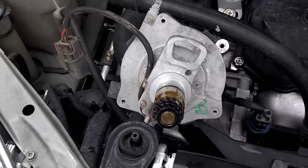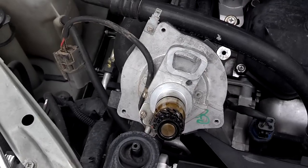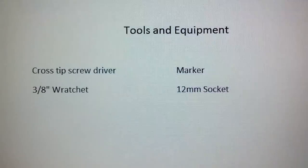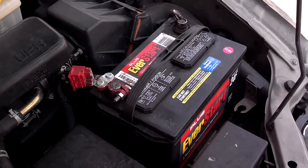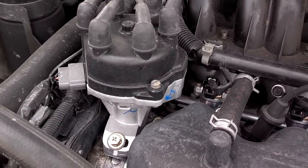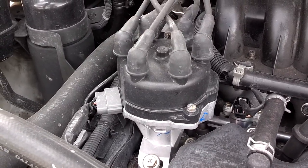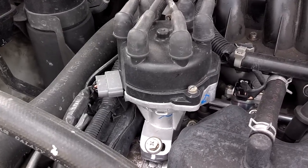You may want to take them up on a warranty because these things new cost about $350, and out of the salvage yard you could get them for about $40. The battery is dead on the vehicle so I cannot pull the codes. When I pop the hood it appears that somebody has already replaced this distributor with one from the salvage yard, and the owner didn't indicate she had any knowledge of this.